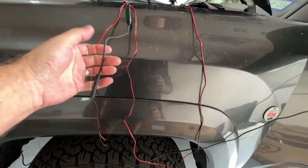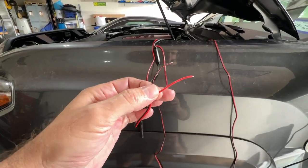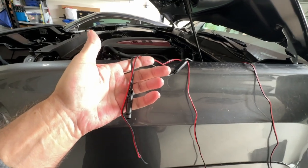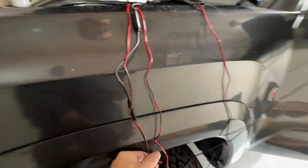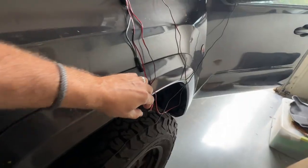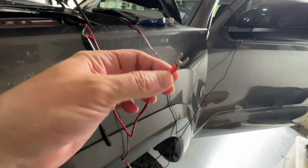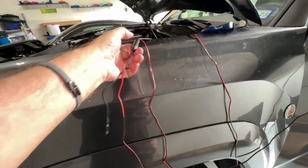We're going to start with the wiring that goes inside the truck. Connected to it you have a black and a red wire. The red wire you can cap off — you're not going to use it. Put some sort of an end on it, tape it up or whatever. The black wire is going to be grounded inside the engine bay once we pull this wire all the rest of the way through. Then we have the end that's going to connect up to the camera in the grill area. I'm going to cap off the red wire and put a spade connector on the black so I can ground it in the truck. I tucked the red wire — which I did put some shrink tubing over — against the black wire. Again, we're not using the red wire; it's merely a placeholder.